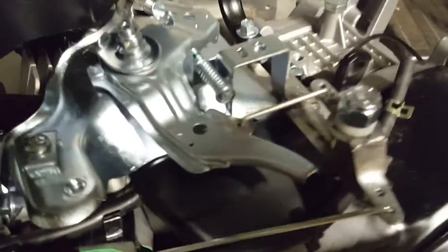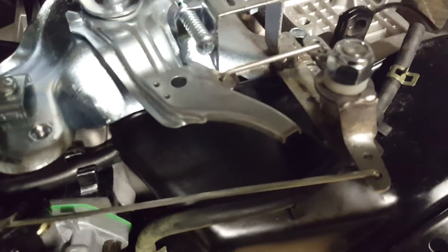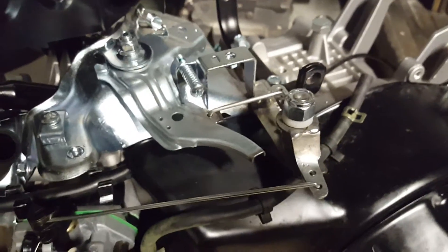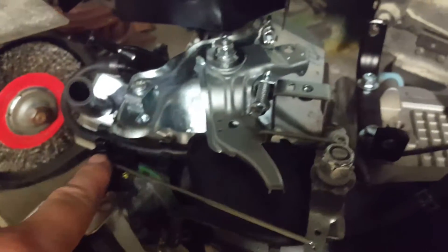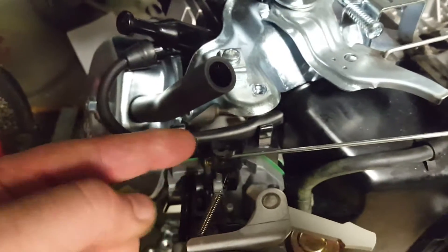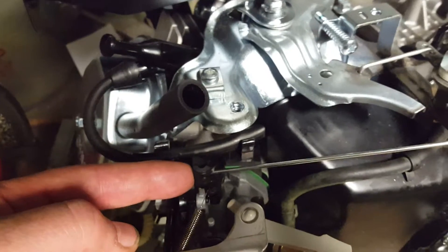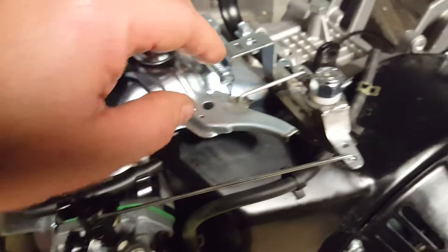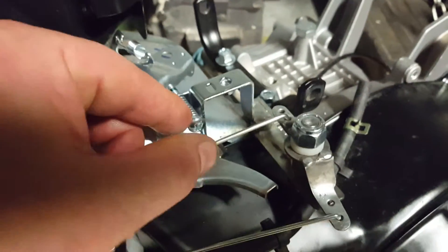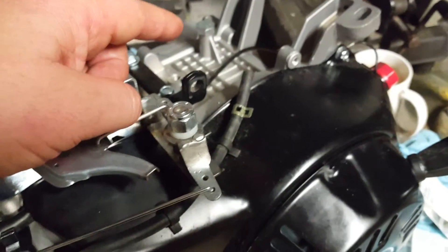This return spring works perfectly fine and the other one takes up the slack. I've recycled most of the materials used — I had to buy very little and it only required about three spot welds, so if you have a welder you're well within your means to do this modification. If you don't have a welder, the alternative would be to make an L-shaped bracket and run the throttle this way over to here to open your throttle, but then you would need a much more substantial return spring on the throttle plate. This way I'm utilizing all of the stock linkages and using the detent screw to govern engine speed at the turn of a screw.